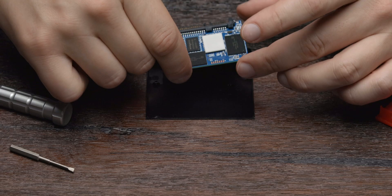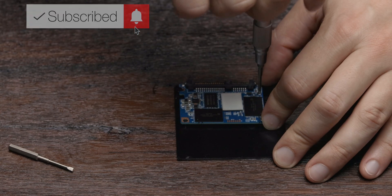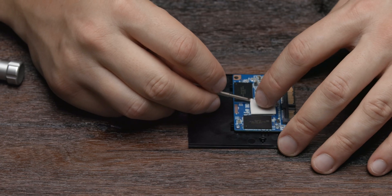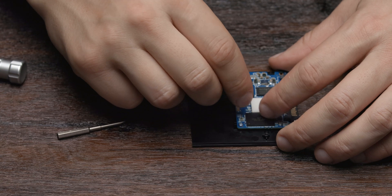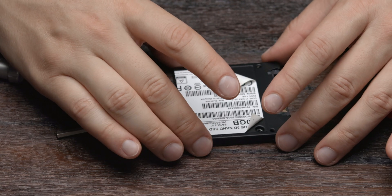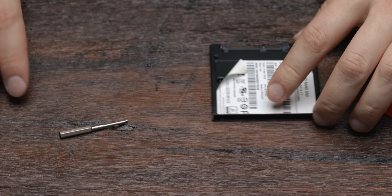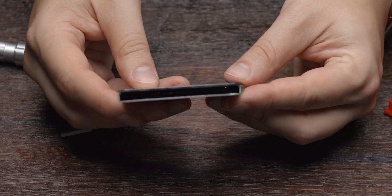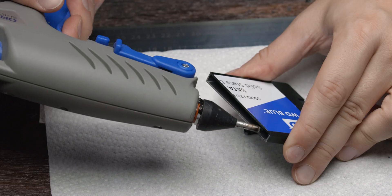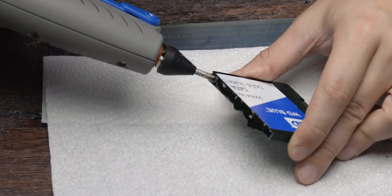After the cut, take your vacuum cleaner and remove all the shavings and sawdust. Now it's time to reassemble the SSD. Reinsert the SSD into the plastic bottom of the housing and tighten down the two screws, but be gentle so you don't damage the plastic threads. If the heatsink got misaligned, remove it with a screwdriver and put it back flush so your SSD won't get any heat damage. Put the lid back on, install the two screws you removed prior, and seal off the screws with the sticker if you left it on. Finally, seal off the hole you cut using hot glue or duct tape — make sure to seal it so nothing unwanted can get into the SSD.